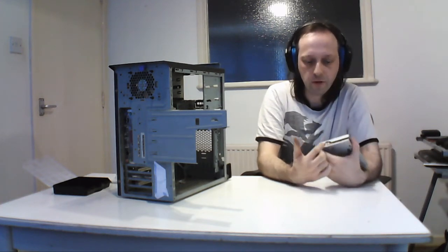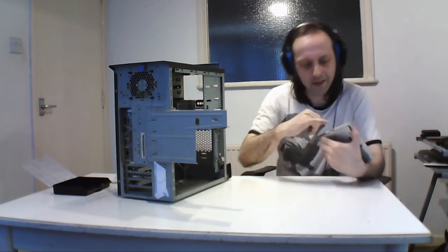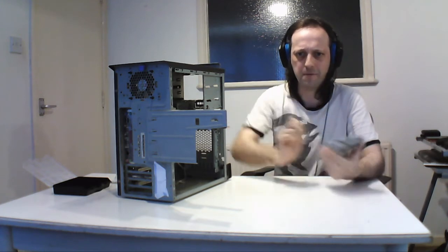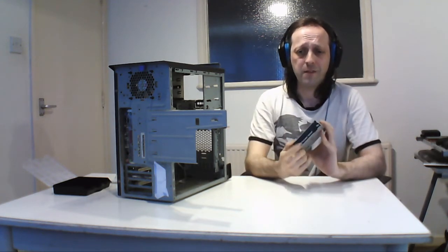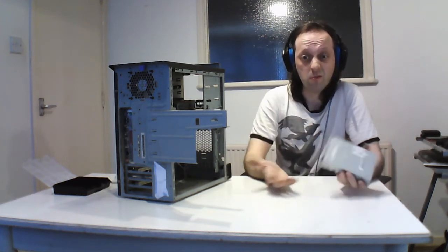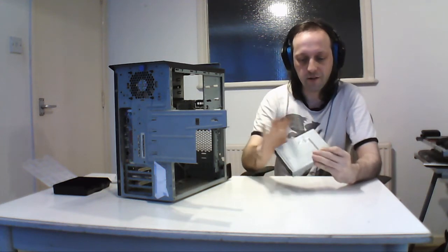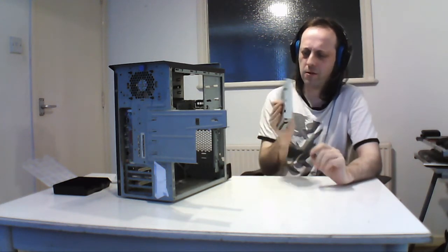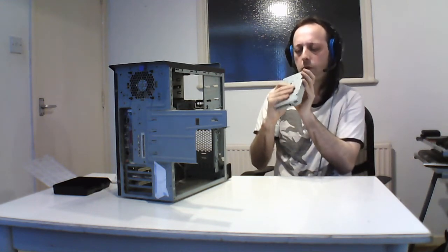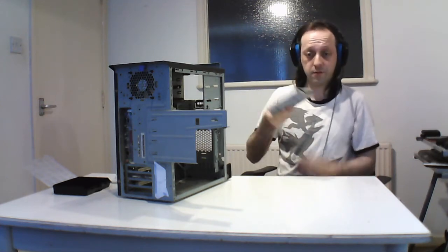Generally it has a standard floppy controller and power connector, and there's a little notch so it only goes in one way. Some of them didn't have notches, and if you put it on the wrong way, the floppy drive light consistently stays on and it will not run, so you just reverse the cable and it would work. But that's a standard floppy drive. It's shielded, so you can take it apart and clean it, but I don't think I would do that, because it's not used often and it still reads. I've got all 3 floppies that read it, this is only for that. But yeah, standard floppy drive.